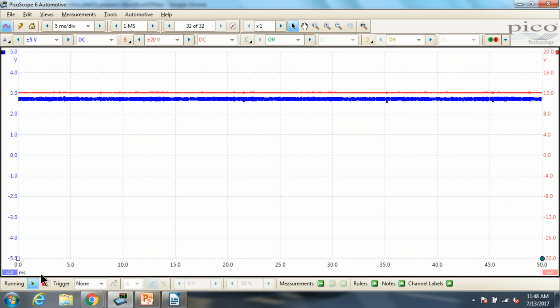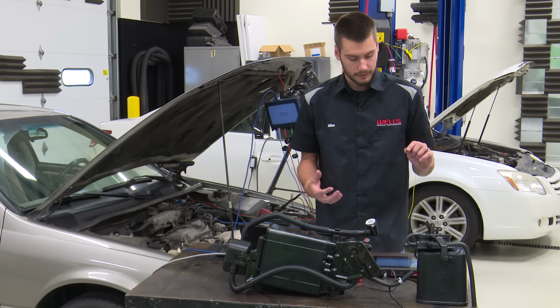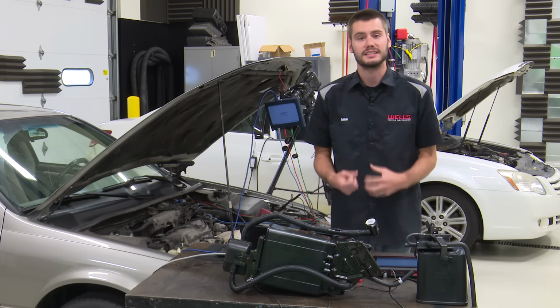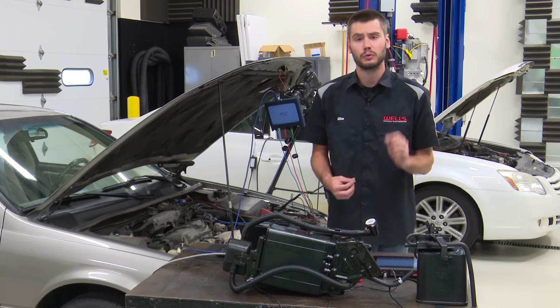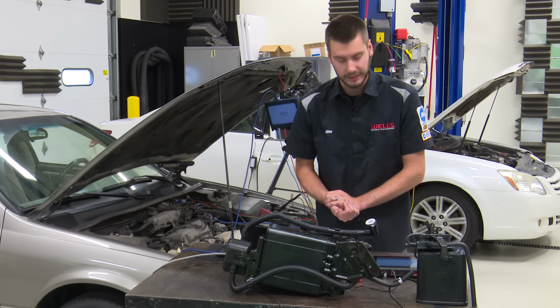Okay, the scan tool is only commanding our bypass solenoid on for a very short amount of time. Let's call it a few seconds, right? In these few seconds, the control PID on the scan tool is not switching back to the off position. So don't get burned on this with your scan tools, guys. Make sure you have a good idea of what you're looking at.